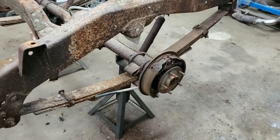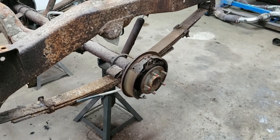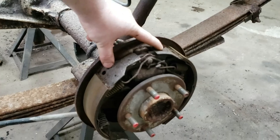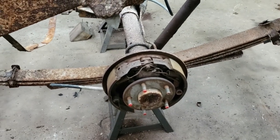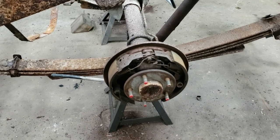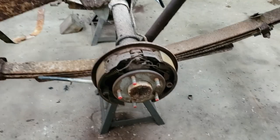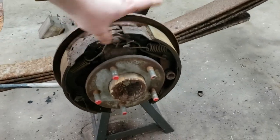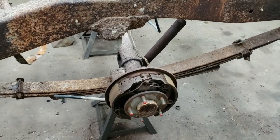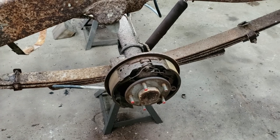I'm just going to go ahead and do the brakes. With bonded shoes, which is what these are, the shoe material is glued to the steel backings. What happens is, if it's old or it's got corrosion - it looks really good right now - but if I put it all back together and start driving and have to make a couple hard stops, they heat up and when they heat up they delaminate. The friction material peels off, gets wedged in there, and ends up destroying the drums. I've seen it quite a few times, unfortunately. Considering I already have the parts on the shelf, I'm not going to mess around. Plus it gives me all new brakes all the way around.